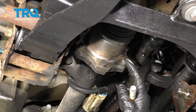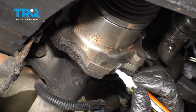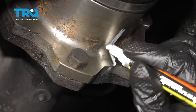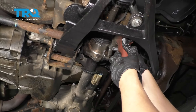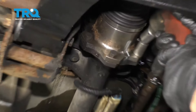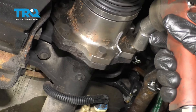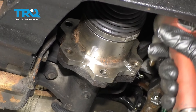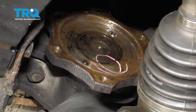I'm gonna need to remove these front axle bolts. Before I do that, I'll mark this just to put it back to how it was when I took it apart. Now I'll take these bolts out using a 15-millimeter socket. You can rotate this and take that out, and you can just grab this and move it to the side. You can do the same on the other one.